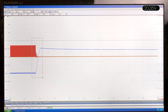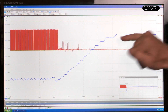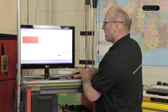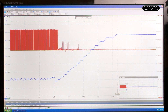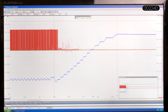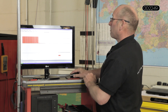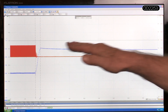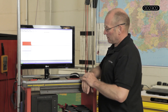This part of the test examines the integrity of the pump — the ability of the pump to increase pressure with every compression rotation. You can see it has done that very well: the pressure rises, holds, rises, holds, rises, holds. Looking at the rise time going from around 300 bar to around 1300 to 1400 bar, that has taken 0.687 of a second — just over half a second, which is an excellent result. Clearly that pump is being primed well and is holding pressure.